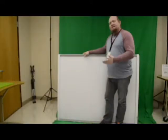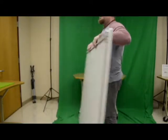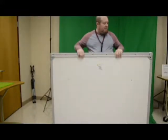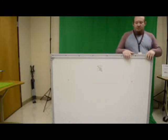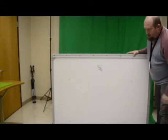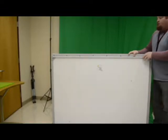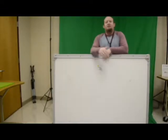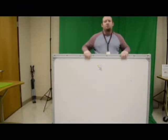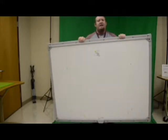Let's say this is actually mounted to the wall. I'm going to show you a couple things on how it looks in the back. Typically you should do a two-person operation on this, but because it isn't mounted to the wall, it's not going to be a huge issue. There are four screws — you can see them here, one over there, one down there, and one down there. You're going to need all four of those to mount it to the bracket. Most brackets come where you actually put the screws in, then you put it in and it seats. You set it to the right height and tighten up those screws.